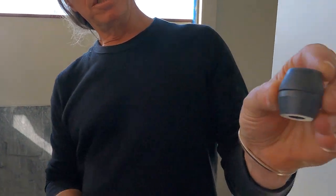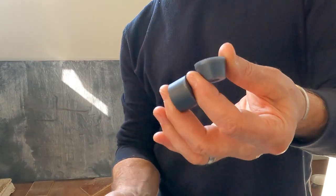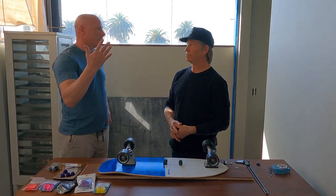Carver offers two sets of bushings. One is a looser set, one is a firm set. Carver makes a standard bushing set, which are both conical — top and bottom — the 5'6 and 6'5. And then we make a barrel bushing, which is the same durometer, but because of the shape it has more mass and therefore creates more resistance — that's our firm setting. On the firm setting you have the barrel on the board side and the cone on the road side. The barrel and firmer setting is for larger people — big guys who need a lot of resistance — and people who prefer a very tight setting. Most boards come with the conical, which most customers prefer. We're also looking to put out new bushings that are yet softer, as softer bushings are very popular right now.